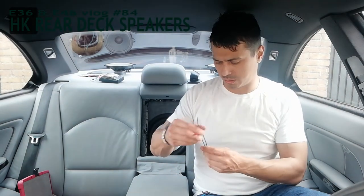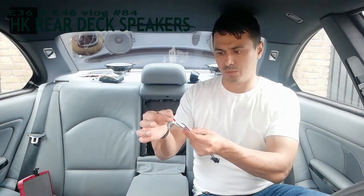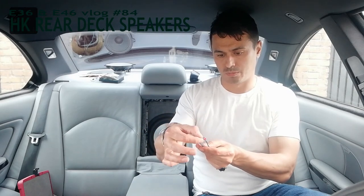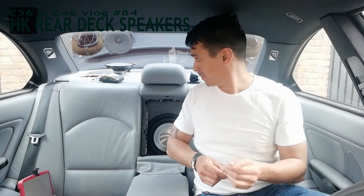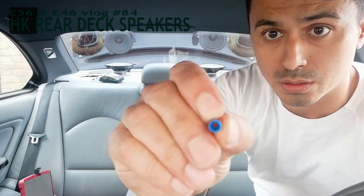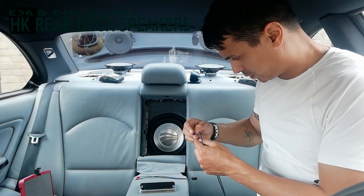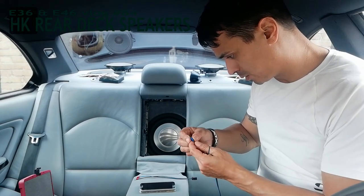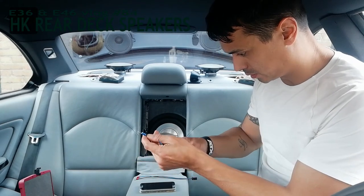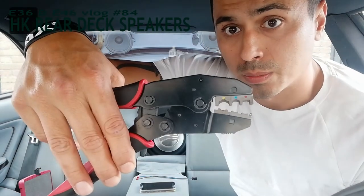The thing with these little forks is if you clamp them, do them straight. If you put them like this, don't put them at an angle on the right side, because then you have to twist the cable. I'm going to use a bit thicker hole because the red ones are really too tight and then the wire is going to split. Make sure they stick out just a tiny little bit.